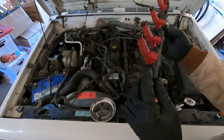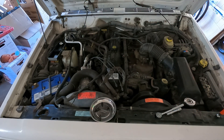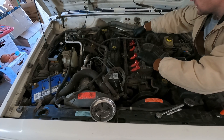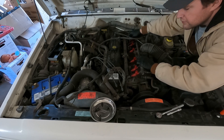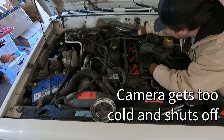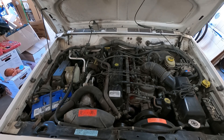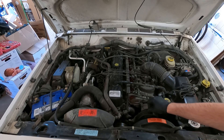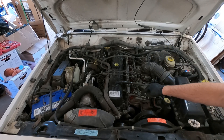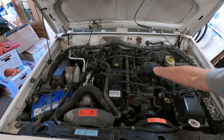I changed things around a little bit. The o-rings are much easier to put in the rail first, and then the clips that hold the injectors in place were also easier to put in without it being in the vehicle. I did vacuum everything in there and tried to keep it all as clean as possible. Apparently I missed recording all that — I thought I had it running that whole time. Anyway, super easy to put back together. Fuel line, easy — pop that back on. There were just the four bolts for the fuel rail that you put on first before you put the fuel line on. You can gently put it together and then use the bolts to tighten it down on the fuel rail and it will line everything up. Then just put those three back together, throw this hose back on. And the last thing I did was the fuel rail.